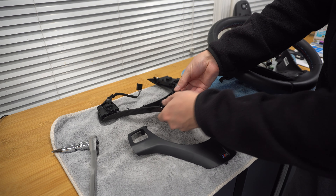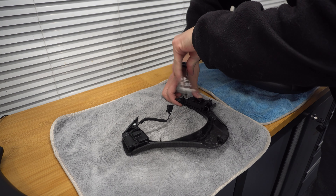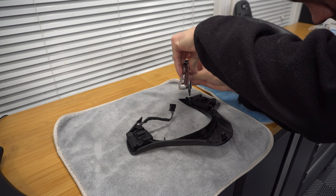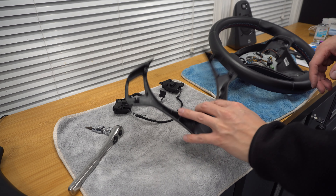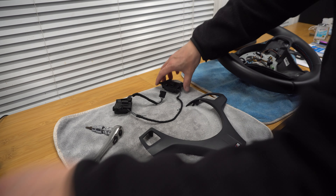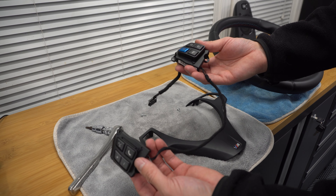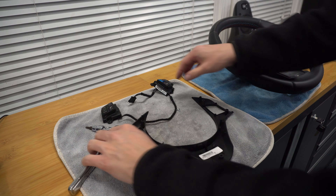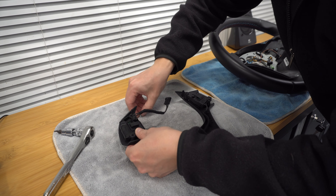It's so much easier to do it like this off the table. Plus it gives me an opportunity to show you what the backside of the steering wheel looks like. Once again — screw here, screw here, and screw here, T20. Now we can flip this wheel over. The rest of this trim is basically just compression clipped into place, so right here on the tops you just need to pull it out. And just like that we've got this piece off. There's the steering wheel — just little compression clips, pushed in right here and right here, and the rest of it's just compression fitted onto the steering wheel.